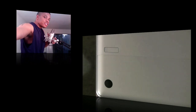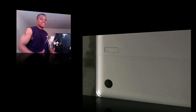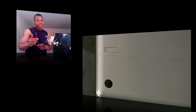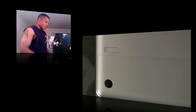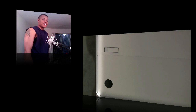This has been Soulja Knows Best — a nice and easy installation to replace a hard drive in a unibody MacBook Pro. This works with a solid state drive or a regular hard drive. You can find the two tools you need — a T6 Torx and a 2.0 millimeter precision Phillips screwdriver — at RadioShack for a relatively low price. Install your new hard drive and start enjoying faster computing. Catch you later, peace.